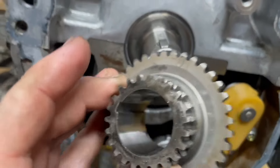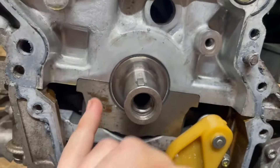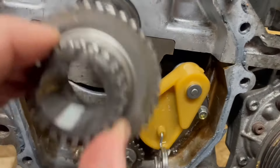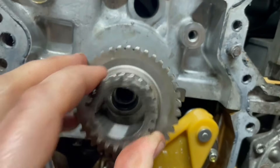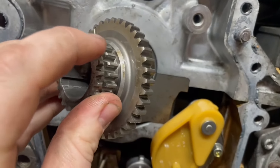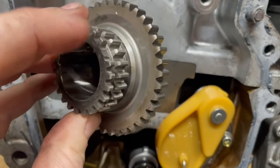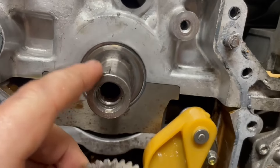Extending the keyway would also take some of the stress off the end of the crank, and the back of it is just the oil pump, which doesn't have a lot of torque going on to it. But if we can spread the load out along the nose and spread the load out along the gear, we might be in better shape. Part of me is wondering if the premature wear and that cracked broken tooth are from this flexing.